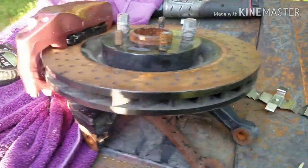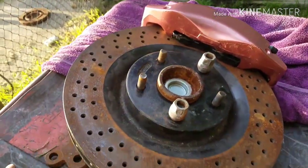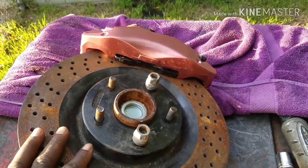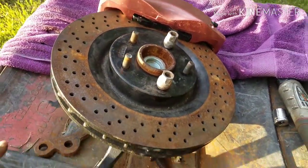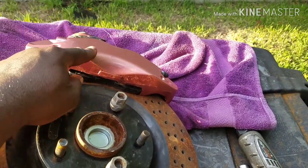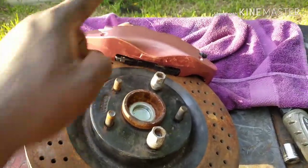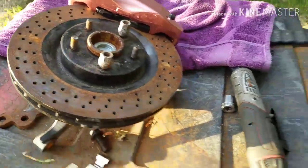But to everybody else, like I tell everybody, the rotor got to match the caliper. It's plain and simple. Yeah, sometimes you can get away, just like we take the C5 caliper and make the 14-inch rotor work with the hybrid bracket. That's a different ball game. With these new calipers, all the Brembos, with the Camaro, Corvette, anything, the caliper has to match the rotor. The rotor has to match the caliper. That's the slight dilemma I have with this one, but it's working though.